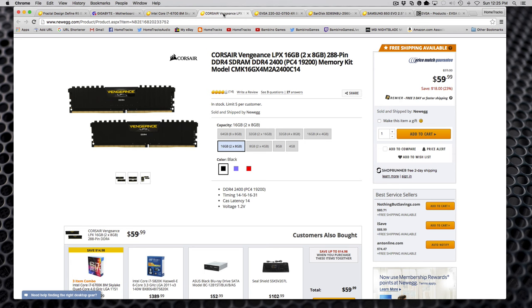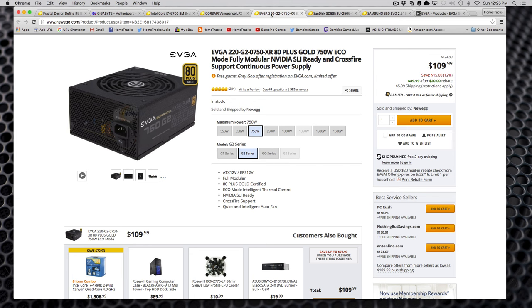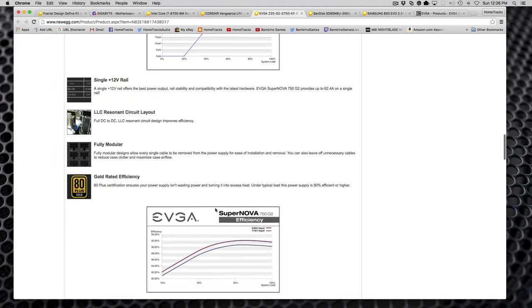For the power supply, there are hundreds to choose from. I chose this one for a few reasons: 284 people bought it and it has a perfect 5-star rating on Amazon, it has a 10-year warranty, and all the reviews are fantastic. It's 750 watts — overkill for my current setup since the GPU will draw about 250W and the CPU about 67W — but it'll support two graphics cards if I ever want to go that way. Plus, there's a $20 mail-in rebate from Newegg.